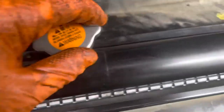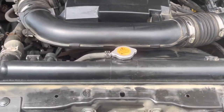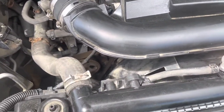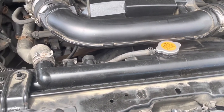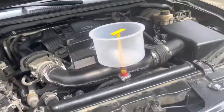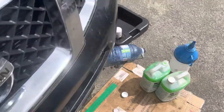Don't forget the hose that goes here - just putting it all back where it came from. Then we're going to fill it with fluid. It's all back together - it's just the reverse of taking it apart; keep track of what you're doing. Snap it all back together and don't take advice from a guy like me - there are better videos online. If you're short bolts, hopefully one isn't like in the radiator. Now we're going to start filling. I don't buy the 50/50 premix because it's expensive - buy the straight stuff and mix it yourself for whatever your climate requires.